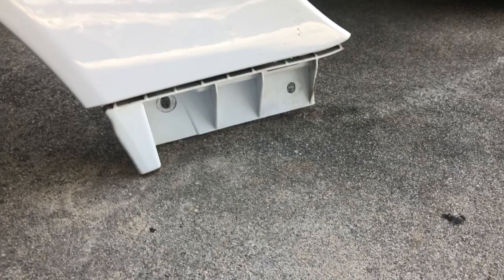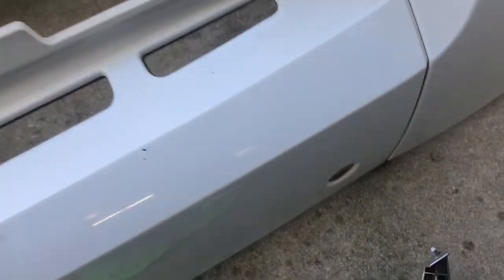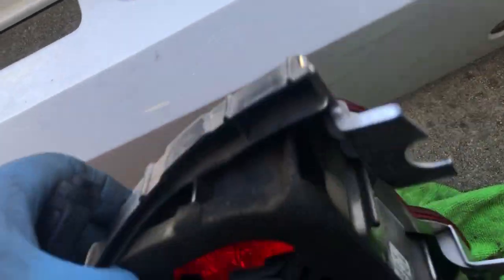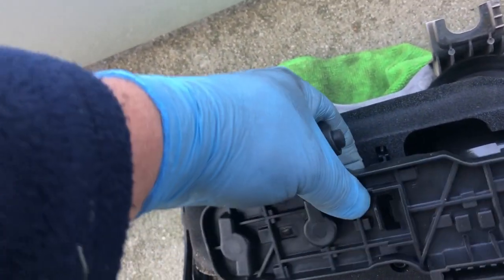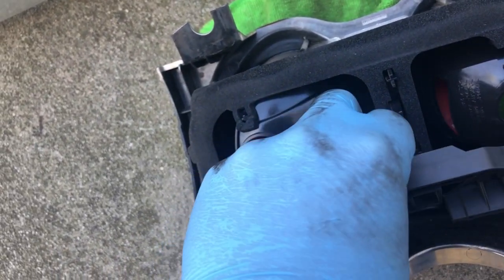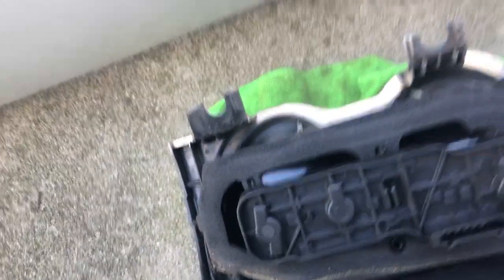There are the other points for your T25 — those are a longer screw. The taillight assembly just goes in. There's this one little locator tab that goes in, and then you kind of rotate the taillight assembly to get it in there. It's held on with a little clip up on top. And right here, this is for your lights — you just push this little tab. There's your lights: taillight, turn signal, and backup light. This is the connector here for the whole assembly, which stays in the car.